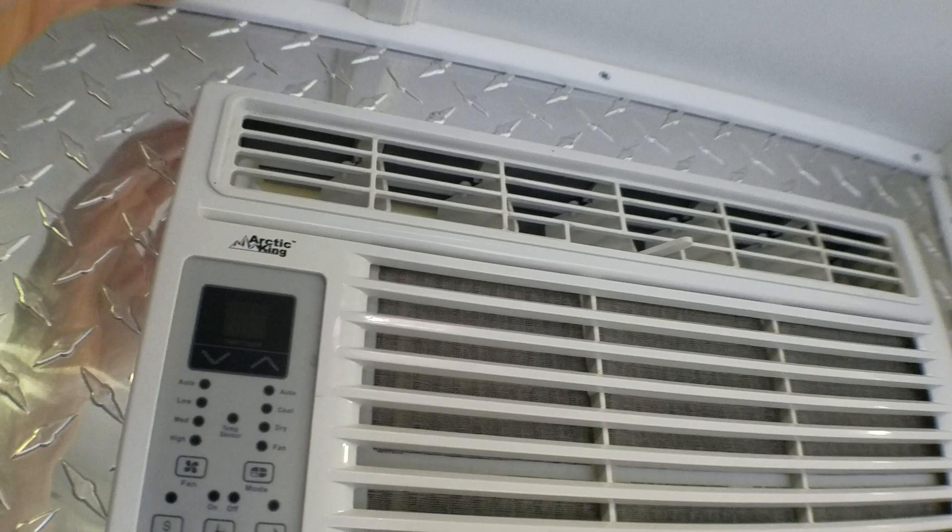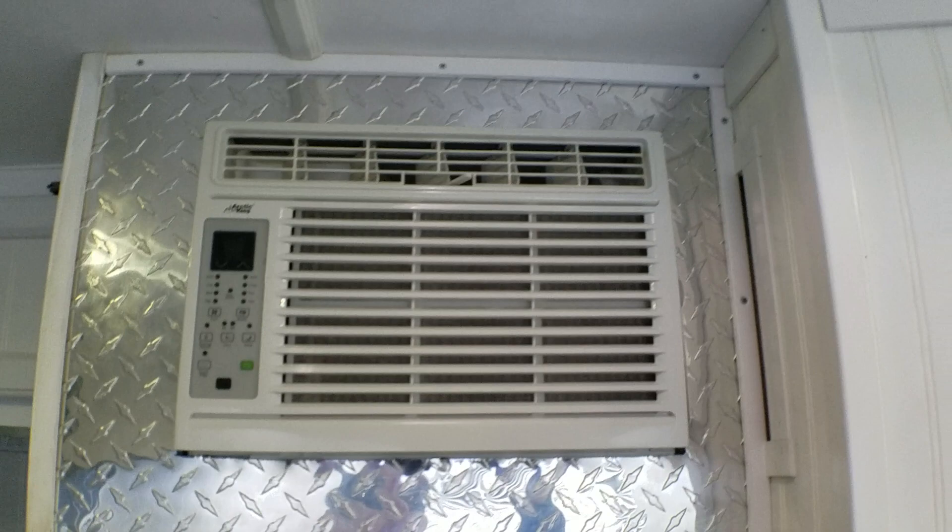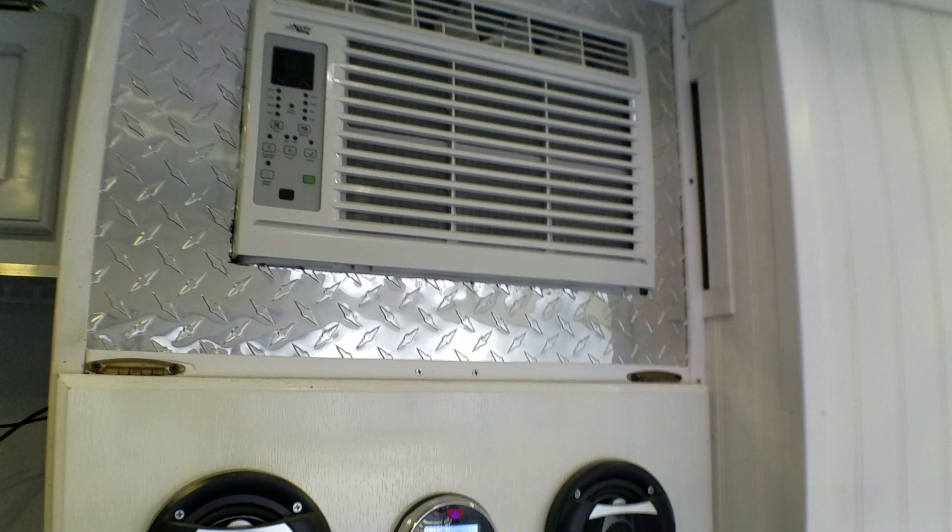It's the air conditioner which is built in — it vents up top. It's got an air conditioner vent on top, pulls air in then comes out the side, all built into a cabinet. The face comes off easy if I need to swap it out if it fails. So far it's been doing great, really happy with it. 6,000 BTUs — cools the trailer just fine on the hottest Florida days. Runs off the little generator as well — runs off the Honda 2000, and on solar for three or four hours as long as you've got a good sun.